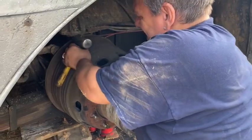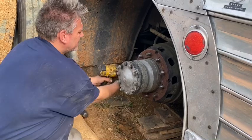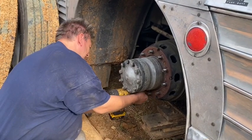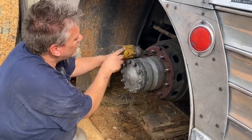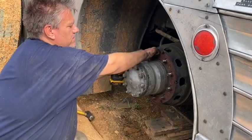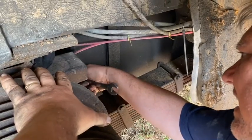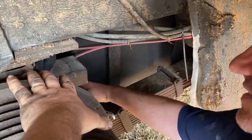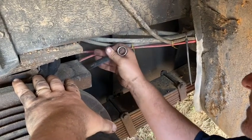That's not an easy angle for a lefty. I'm going to take some questions on there. Just backing off the slack adjuster so I can get the brake drum off hopefully, but I've never had this brake drum off on this bus.